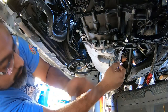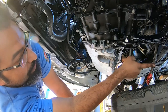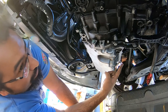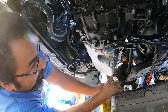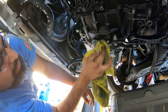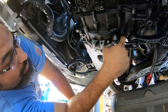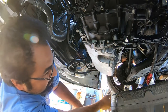All right, so we're back. So we got every single bolt on here except for the drain, the return line. Everything's set to 11 foot pounds. No more, no less, guys, all right? So after you torque everything down to 11 foot pounds, the ones that require a little bit more torque than anything else are your transmission bolts. The 1, 2, 3 bolts here, they're on a 16. Get you guys the torque specs for that.